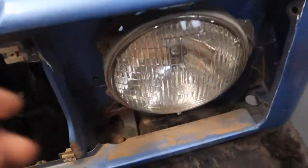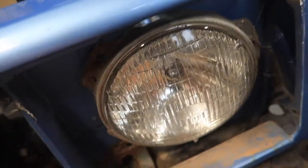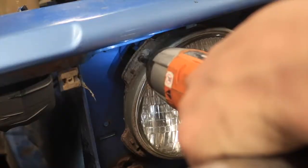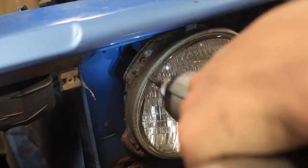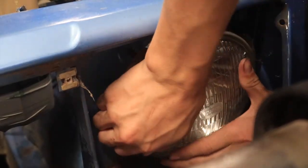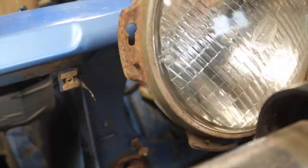After all that is done, you take out 3 screws in here, and they've got a spring behind them. The spring holds them in and gives them a bit of padding. All 3 screws come out, and then the whole globe should pop out. You don't have to undo them the whole way. They've got little notches in them, as you can see, and you just slide them around.